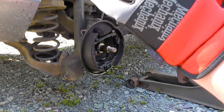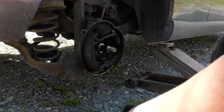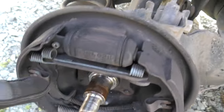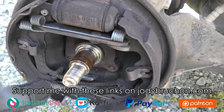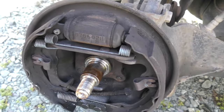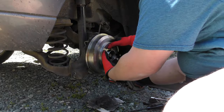There we go. There's some driveway gravel but look at that — that's what's left of that wheel bearing. I'm going to need to clean the PB Blaster off with some brake parts cleaner, and this is gonna need to be greased. We'll put the new drum on. It took a bunch of wiggling but I got it on.